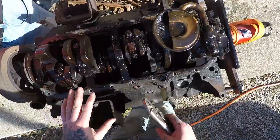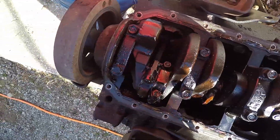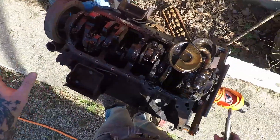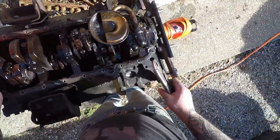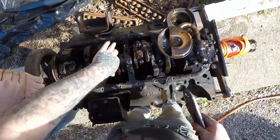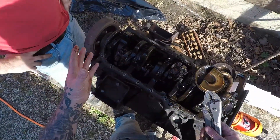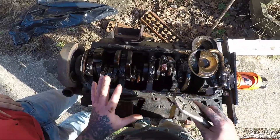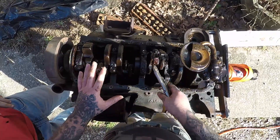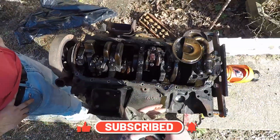So this is inside the engine. It doesn't look like it's ever been into — usually they are numbered or stamped if it's been opened. So this would safely be a factory engine that's got a little bit of moisture in it, but there ain't no water. Everything looks oil-coated good. The gaskets look factory. This GM motor has rods that feel tight — no up and down play. That's another video — taking the rod caps off one at a time. This one was just removing the oil pan and taking a look at it. Don't get them mixed up — if you do take them off, number them to match your cylinders. Hopefully you enjoyed this oil pan removal and checking this motor out with us. Thank you for watching, see you next time.